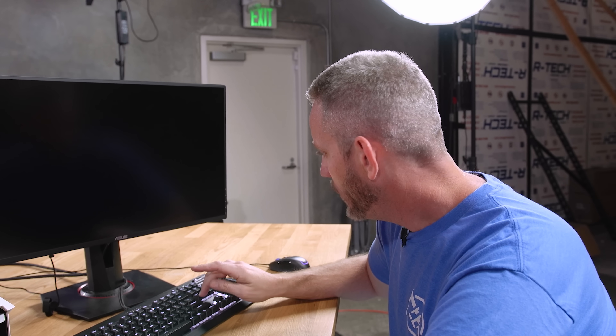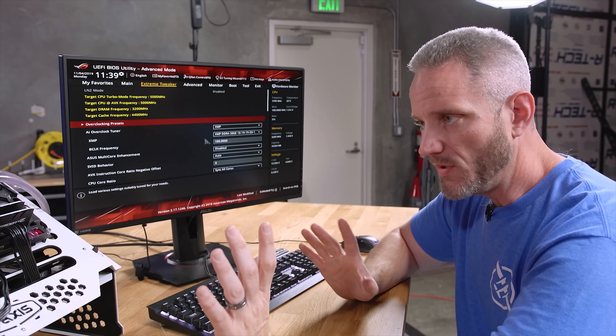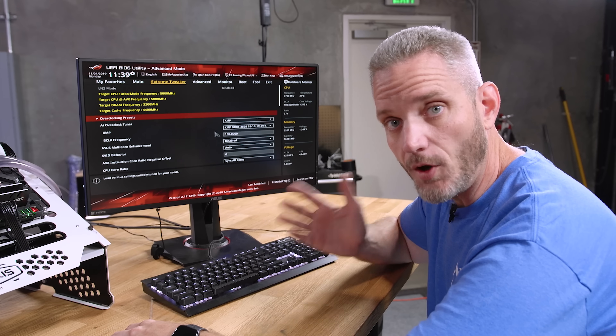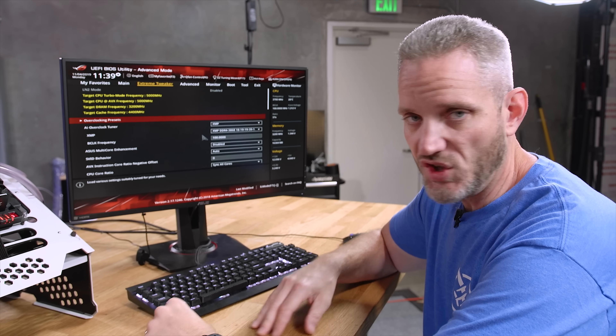What we're going to show you right now is that the system will output VGA. Right here - we just got a blue light. We're going to go to the BIOS here in a sec. This monitor takes a minute to turn on. We've got video. So we know that this is outputting something. But the problem is every time we clean the driver off and we boot into safe mode, we can DDU the driver, but as soon as we start to reinstall the driver, the GPU goes corrupt. We get a black screen, the fans go to 100%. My theory here is not that we killed the graphics card - what we showed in that video is how we corrupted the driver. But getting it back by doing the driver wipe with DDU in safe mode was no longer working. My next theory is that we corrupted the BIOS, because seeing the screen go black and the fan go to 100% is very indicative of a BIOS failure. I think that is happening when we go to write the driver - it's communicating with the card and the BIOS is just borking.